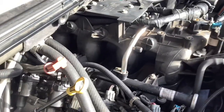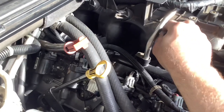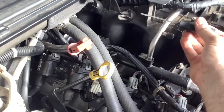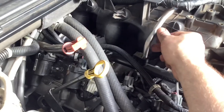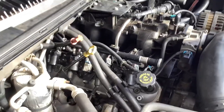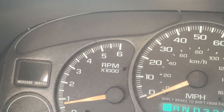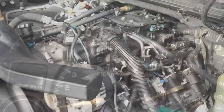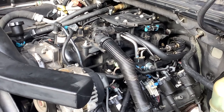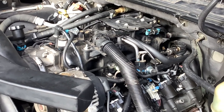I primed the key four or five times, then took my cap off the rail, accessed my Schrader valve with a rag underneath, and used a little screwdriver. It appeared I had really good pressure coming out. I cranked it up and the vehicle's idling pretty well — right around 700 RPM, no service engine codes. I think that intake likes that new gasket. Everything seems to be running fine. It's idling smoothly, so I'm going to take it for a test run. Appreciate y'all tuning in and watching!